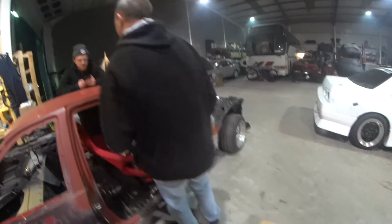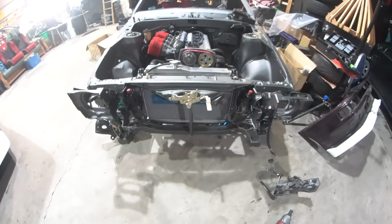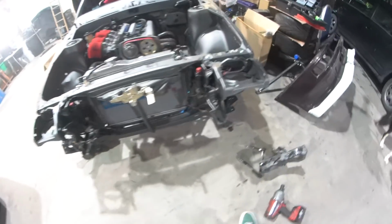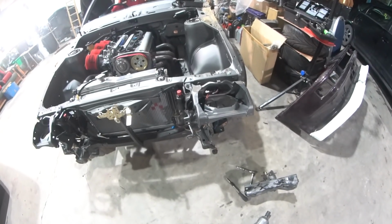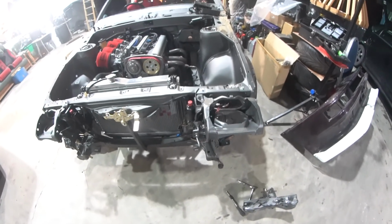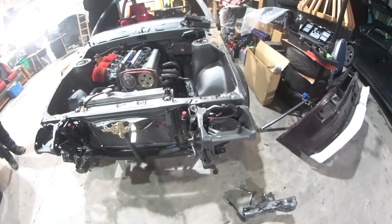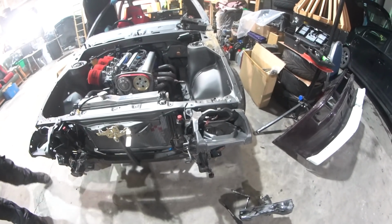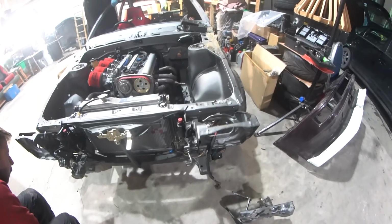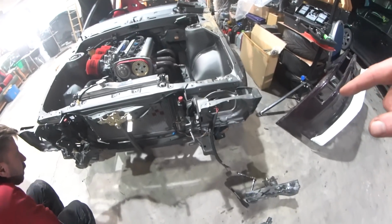Light control. Oh! Woo! See that? That one's not right, look. It goes down first, look. What was wrong, buddy? One of the relays is missing. Why would that be? Because the arm isn't on the right spline on the motor. This is why, same with the wiper motors, it's a nuisance. But there's not too many combinations with this, is there?